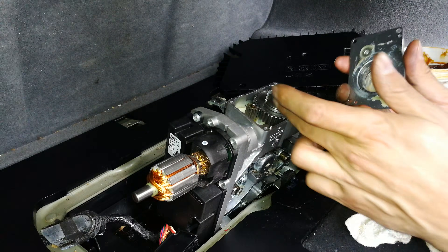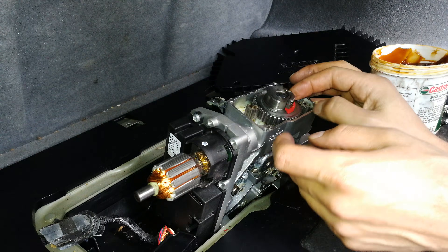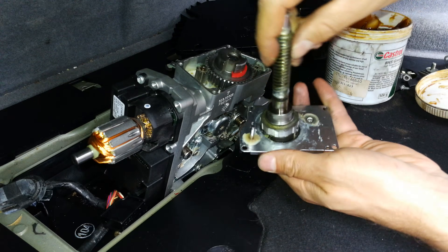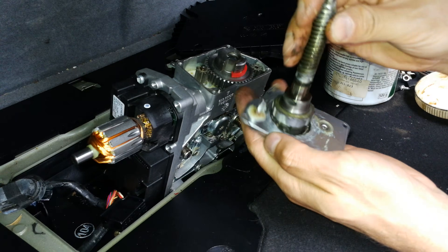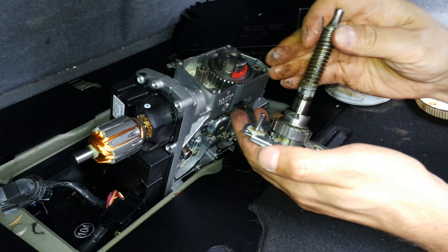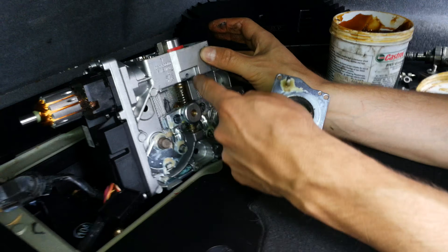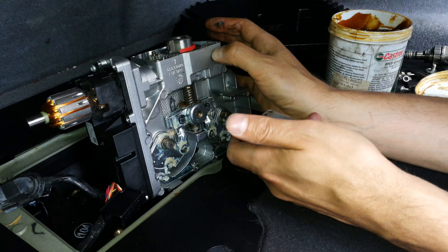Just a few turns and it's in. The alignment here — that and that must align so this thing can move. There's a lip there and a lip there, and this thing has to seat — there's a recess there that allows it to move. So you can't force this in or you'll break it. Make sure it's seated in the right orientation. The shaft doesn't need to thread all the way in — the motor will tighten it and probably measures the pressure.